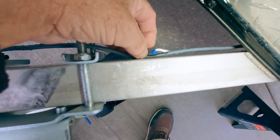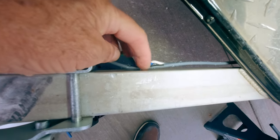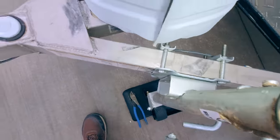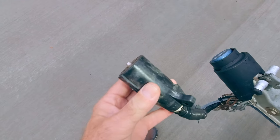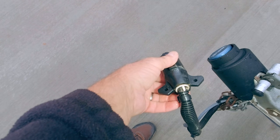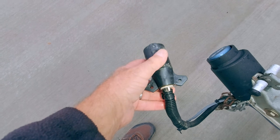The wire is grounded in two places. Right here I cut the ground wire and screwed it to the frame — there's something important I need to tell you about that. Then it continues up into the seven-pin plug. It just fastens inside with a crimp-on eye connector, both the ground wire and the trailer brake wire.